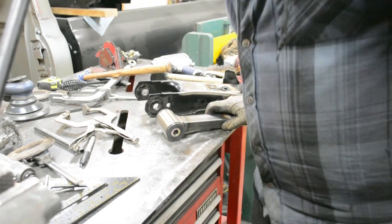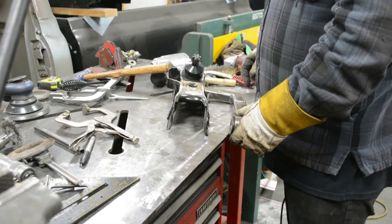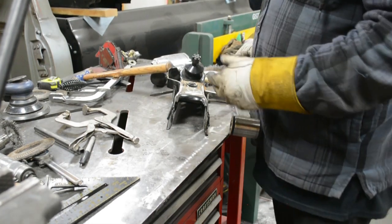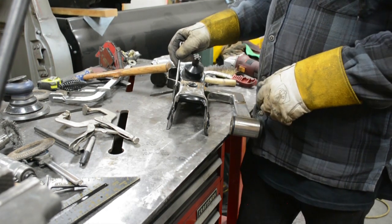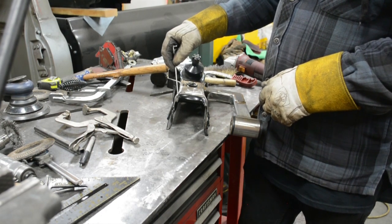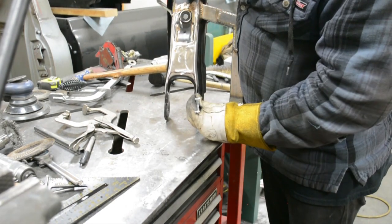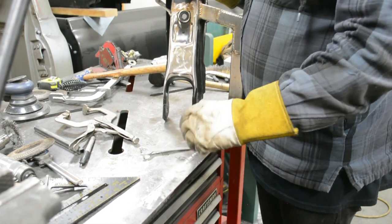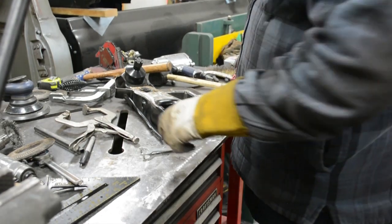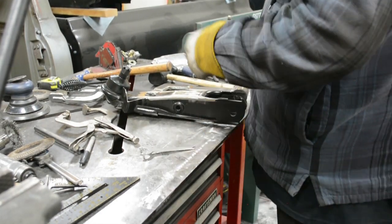We're doing a little more on the lower control arms. The next step is to clearance the arm a little bit. When you're going on bigger wheels, the stock lowers will get in the way. So there are two things you can do, but we're actually going to do both. The first is we're going to clearance the inner arm here — trimming it along these lines and bringing it around. We're also going to clearance the crossover section of the frame to allow the arm to go up nice and high. We'll get to that when we get there, but for right now we're going to trim this to fit.